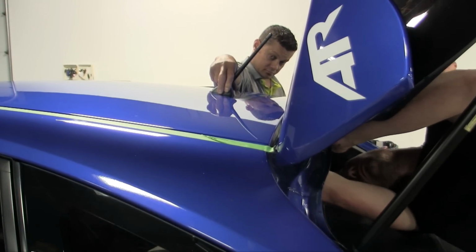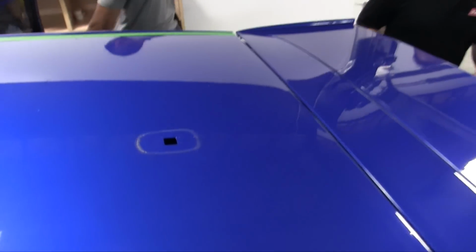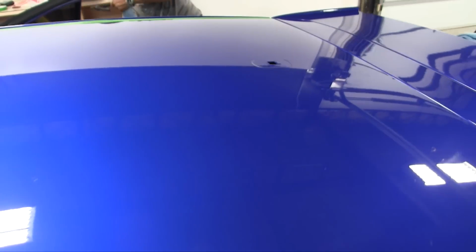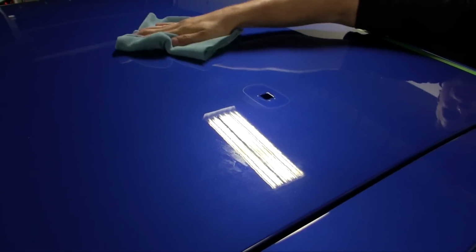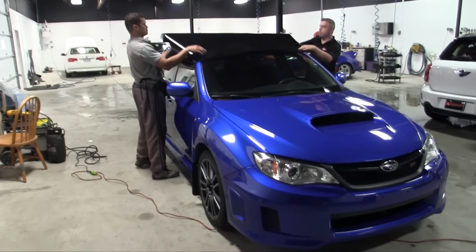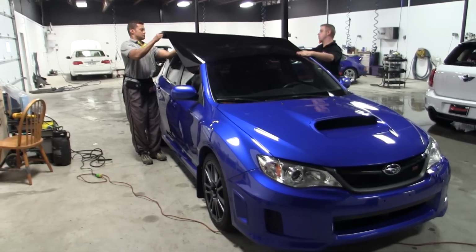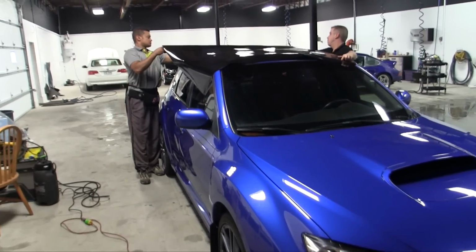We had to get the antenna off the rear because obviously when you're wrapping your car, you need a completely flat surface, so that's why it was clay barred and everything. And the roof was completely clean, completely free of everything. So we need to get rid of that antenna, which involved removing some of the rear panels and some of the rear hatch trim to be able to unscrew it and undo it, and we finally got it. Then after that, we put the vinyl on and we sized it up.